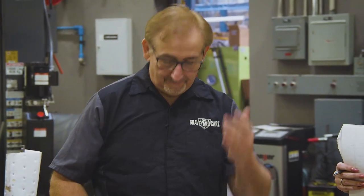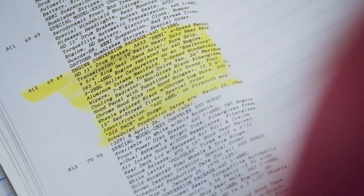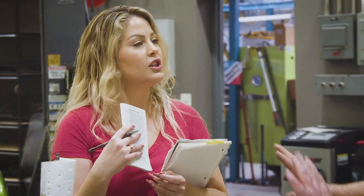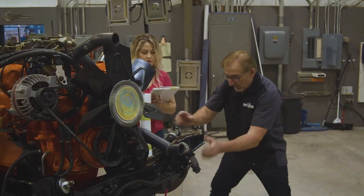What else is guaranteed as part of the 69 and a half A12 Super B package? The lift-off fiberglass hood. Yes, that makes it pretty cool. And probably a bad-ass stripe of some kind. A12 69 engine conversion package, 440 — three two-barrel carburetors right here, folks. Una, dos, tres. How many CFM on those three carburetors? 1350 — 500 CFM outboards, 350 center. HD 11-inch drum brakes right here. A833 — Hemi 4-speed transmission. This is your VIN number that tells you it's a real live numbers-matching transmission. The last eight characters: 9A284123. And what assembly plant is represented by the letter A? Lynch Road. All A12 cars were built at Lynch Road, so all A12 cars will have the A as the assembly plant.